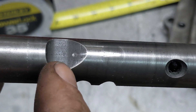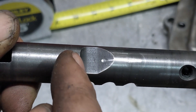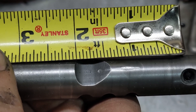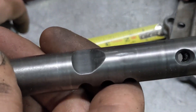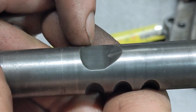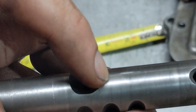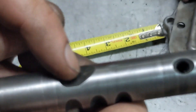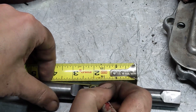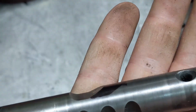The next one — we need to extend this one toward the shallow ramp. It needs to be one inch overall from here to the end of the shallow ramp. Right now it is about five-eighths. This bottom part, where it's flat at the bottom, needs to be five-eighths wide. Basically this flat part here needs to extend all the way to where this round part is, and then ramp up with a similar profile to this afterward. In the end it's going to look like this. So I'll take that over to the grinder and do that.